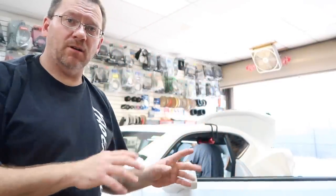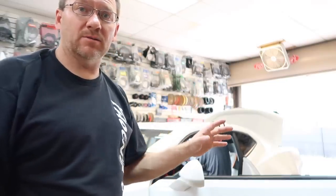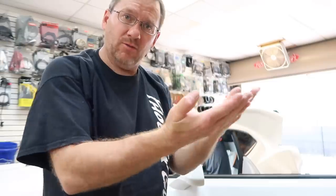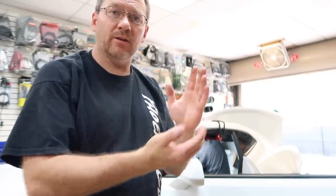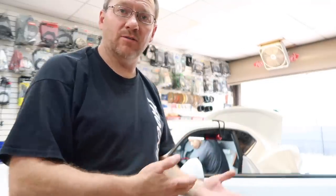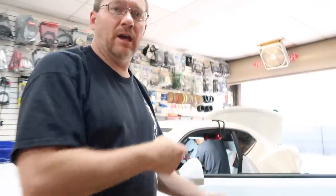With new cars being as fun as they are, one of the things we want to test in this car is the sound output, meaning what's coming from the radio. Is it different when the speaker is connected versus not connected? Now that we have the rear speakers out, one of the tests we want to do is take our RTA and hook it up to the left and the right, one with speaker, one without speaker, and then compare the two side by side and see what that signal looks like. In some cases, you're going to get a totally different sound out of the left from the right when the speaker's not connected, and that has to do with the load from the speaker onto the factory radio. We want to compare those two and see what they look like. So we've gone ahead and done that. Let's go take a look at it in the car.